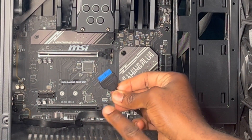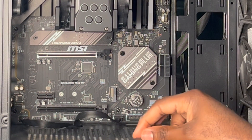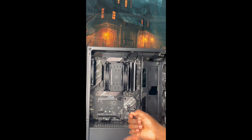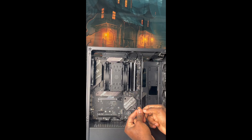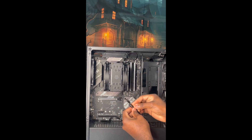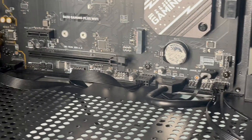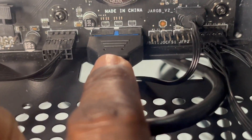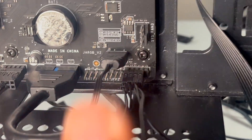Next we have this cable with a blue piece with a notch on top — there is pretty much only one thing on this board with a notch on top, so it goes right in there. Last but not least, we are going to wire in the power button, the reset button, power LEDs, and other LED lights for the case including for the fans. If they come like this, you can get an adapter where they all plug in and then plug in directly — I never got an adapter so we're just going to do it manually. Just like that, we have all the case cables plugged in: HD audio, USB, RGB, and the power, reset, and LED cables.